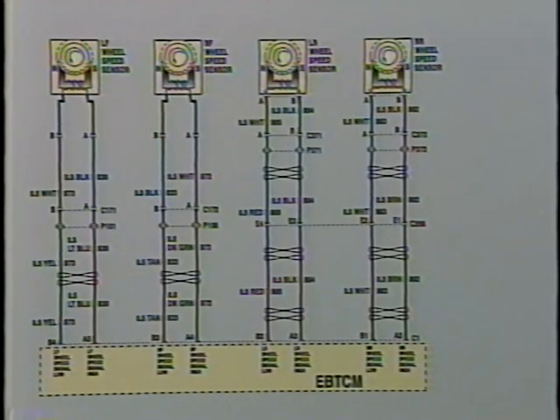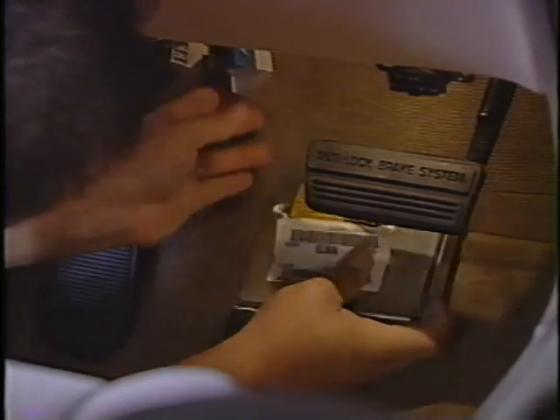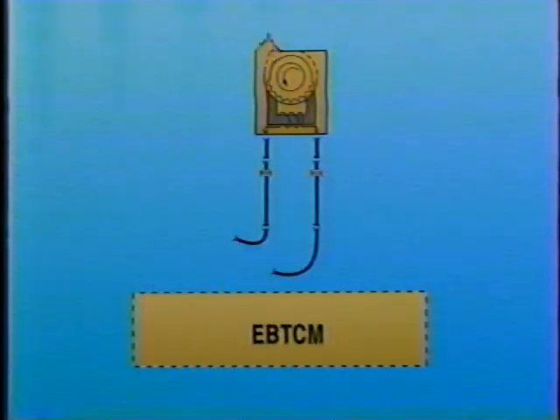But whether or not the light comes on, your next step is to measure resistance in various sections of the circuit. In most systems, the wheel speed sensor circuit has three sections: the sensor itself, possibly including a short pigtail harness; a special jumper harness; and a main vehicle harness. Water may well have entered at the sensor connector, but you know not to disturb that connector yet — there could be a short to ground anywhere in the circuit. For systems like this one, which include two exposed connector locations, it makes sense to first disconnect all connectors at the module. In the Intrigue, this module is located below the instrument panel on the left-hand side. Now the entire circuit is isolated for your resistance checks.